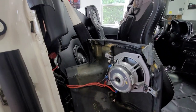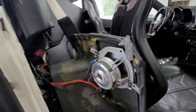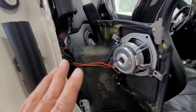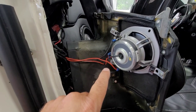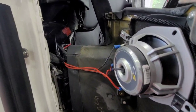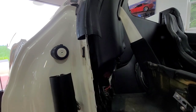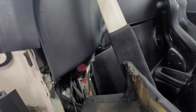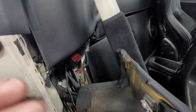I've got this panel slid out — it's kind of tucked up there and catches the upper panel here, so pull that down. This has an aftermarket stereo in it so your wiring may be different, but I'm going to note where these wires are and then disconnect them and proceed on. As you can see, the reel we're trying to get to is behind here. This one has extra material a standard 458 would not have, like these speakers back here, so you won't have this extra panel — yours may be different.